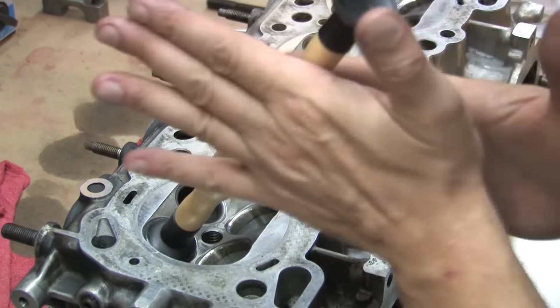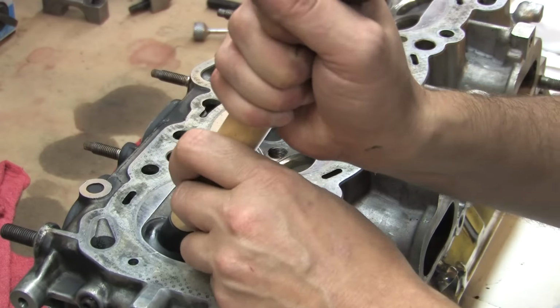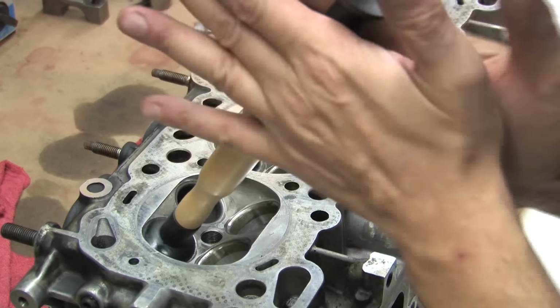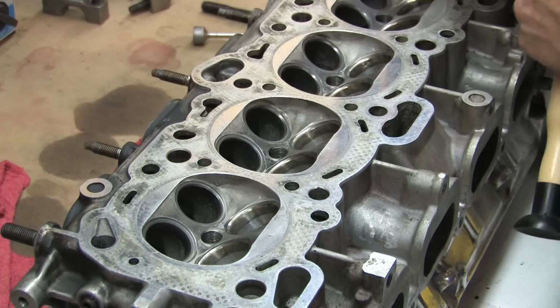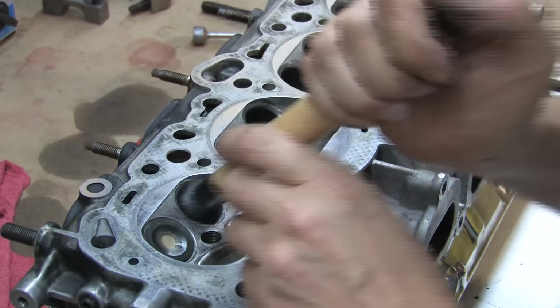The technique is as simple as what you're watching. You'll hear the valve seats change pitch as they grind down. Periodically pop the valve against the seat to splat the compound when it starts changing pitch. Eventually the compound breaks down and leaves you with a smooth seat. I rotate the valve 90 degrees each time I pop it to make sure I grind the faces evenly.